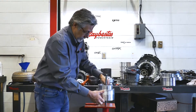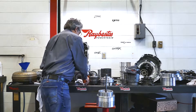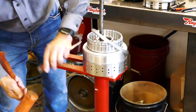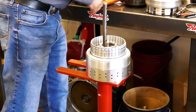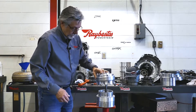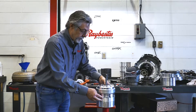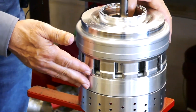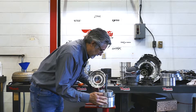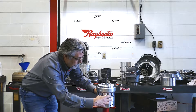It just so happens I've got a 10R60 F-clutch assembly here along with the C and D clutch. This one's going to be a little bit different and I'll show you why. Again, pop the ring off. Now I can still use the same piston, but notice when I put it on there, it goes over the outside edge which is actually part of the drum — it doesn't sit on the piston to compress the springs underneath. So remember: you took this ring off, turn it upside down, put it on the F-clutch piston. Now we can use our overdrive piston.